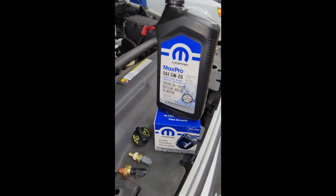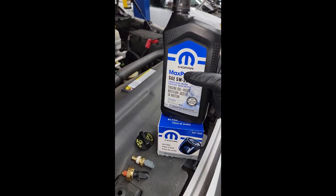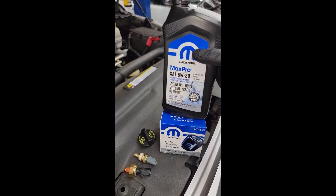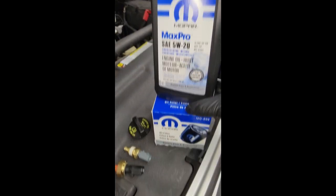You can very well fix that by simply using the correct oil, but because this truck has a lot of miles, I'm going to replace the sensors and go back in with seven quarts. This is a Hemi — it takes seven quarts of oil. Mopar Max Pro — y'all see that — and a Mopar filter. I'm about to change the oil. These sensors aren't hard to replace; I find it easier to do them with the vehicle in the air.